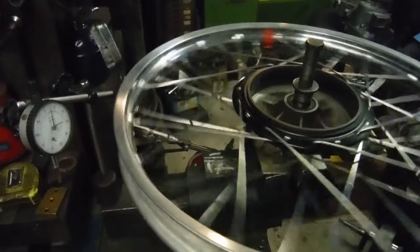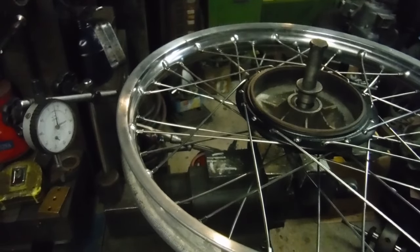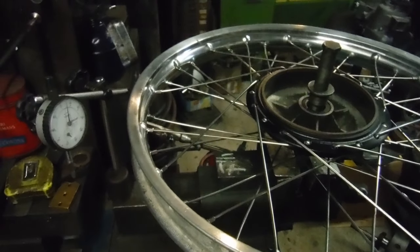I'm going to zoom in now and hopefully explain something that's going on here, because I don't think this rim and this hub are compatible with one another. Notice how there's a very slight bow in the spoke — going like that — and the corresponding opposite spoke is doing the same in the opposite direction. Where the spoke nipples come through the rim, the spokes start trying to bend away from the direction that the nipples are pointing in.